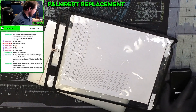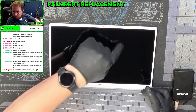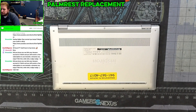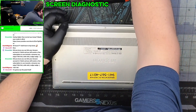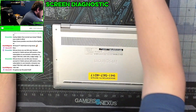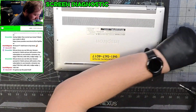Take a look at this one. I think this might be either real complicated or real hard. I'm going to check a couple of things on this because it's either the screen or the screen cable is damaged — the screen needs to be replaced or the screen cable is damaged. The way it looks, he said it was dropped. He's expecting to replace the panel, but I just want to check some stuff first. Definitely looks like the panel.